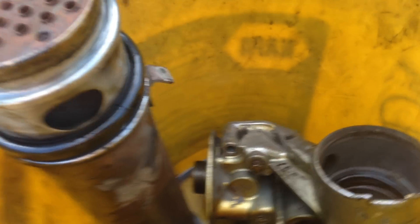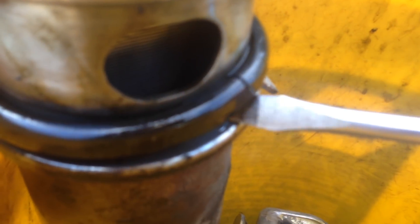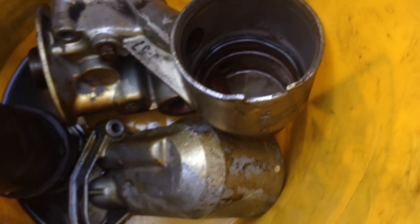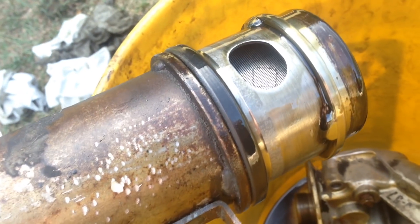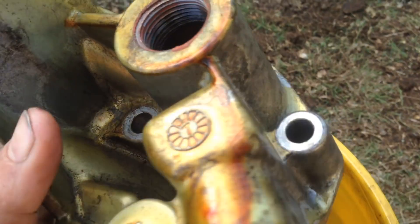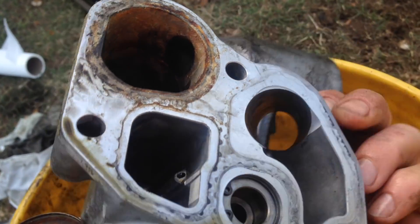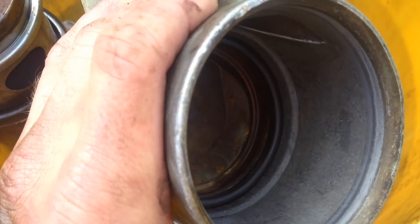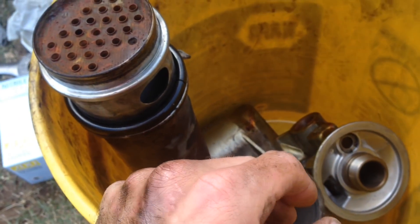Now pulling off the seals from the oil cooler — you can see that one just cracked right off, so no wonder this thing was leaking. There's a seal in there, another seal in here. I'll look around to get all the seals out. There's one up here on the oil cooler, another lower one, and a seal that got stuck still inside. I count about four seals total — four O-rings — and then there are also gaskets.